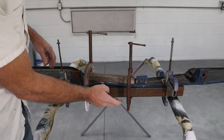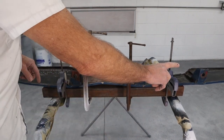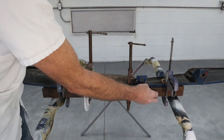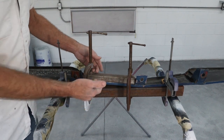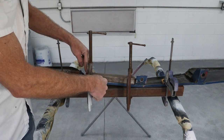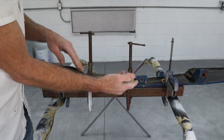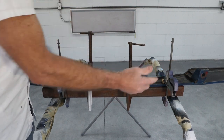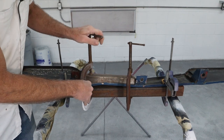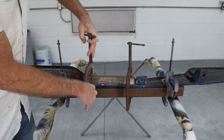What I've got set up here is a piece of square or rectangular tubing — pretty good size, just some scrap I had laying around. I've got two squeeze clamps just holding it, pulled flat against the rectangular tubing. Then I've got a piece of inch-and-a-half tubing right here with some C-clamps. I've got it pinched down here and I'm going to use that as a lever to push down right across here and see if we can get this pushed down. The sheet metal is going to get longer as it goes; the squeeze clamps have rubber feet so it'll slide and we won't bind it.